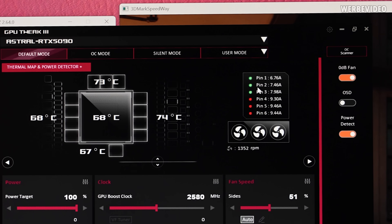It's still such an annoying topic. I also measured the noise level on this card from 20cm distance in Q-Mode: exactly 45dB, which is a little bit less than the 5080 because the 5080 was running at a higher fan speed. The 5080 is a little bit more difficult to cool — which sounds odd considering it dissipates less heat — but the 5080 has a higher power density on the chip, so the chip is not as easy to cool as the 5090. That's at least my assumption why we saw higher fan speeds on the 5080.